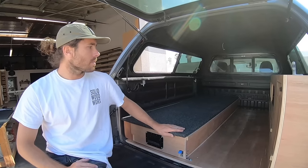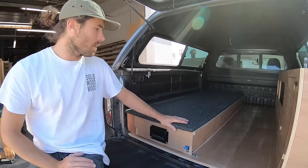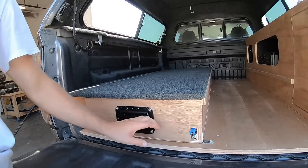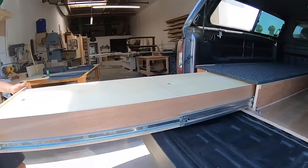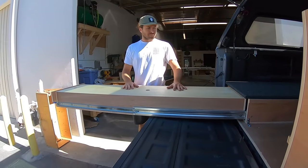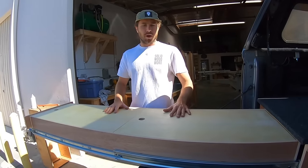The back of the bed here is six foot exactly. He wanted to make some sort of a cool little Baja-style build like I've done before. So to walk you through this real quick — on this side, we have a carpeted top about 26 inches wide, and underneath it we have a massive drawer. This is on five-foot, 500-pound Lockian drawer slides. He wanted this so that he has a nice area to cook and prep food, and he can still sit on his tailgate while cooking. He wanted to keep the drawer just over the wheel well so it's slim enough to not be super high up when he's cooking, when you add the stove and the pot of water and all that.